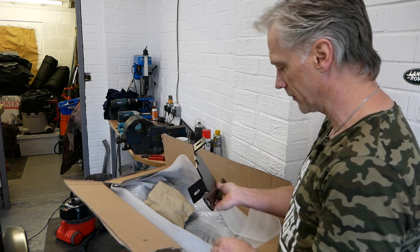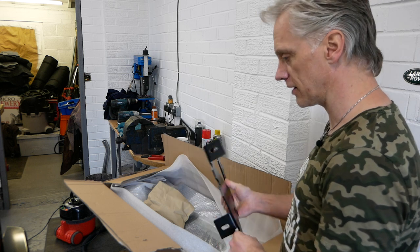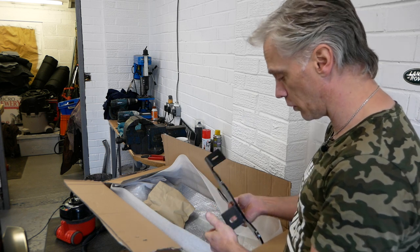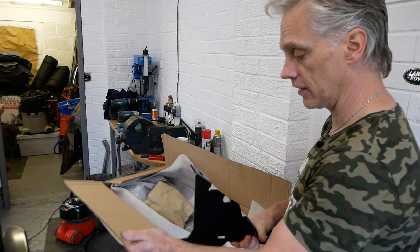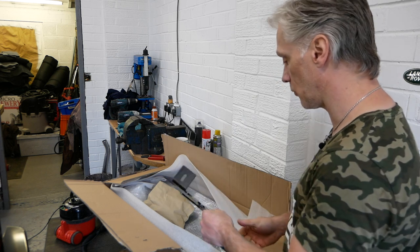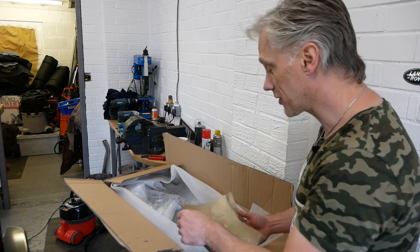We got in. Now, it's a 5mm steel steering guard. I haven't gone over the top because, like I've said before, this is not an off-roader, it's an overlander, and this is just to protect the steering damper, really, because everything under there, apart from the steering damper, is all heavy duty or already protected. So I just went for a 5mm. You can get much thicker, much stronger ones, but 5mm will be fine. It's not too much weight. That's what I'm concerned about, weight more than anything. I guess really I should have gone for an aluminium one, but price, that's the problem.